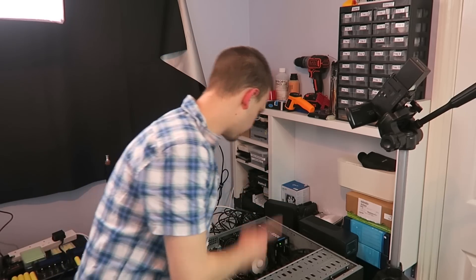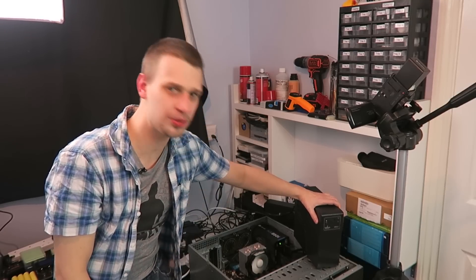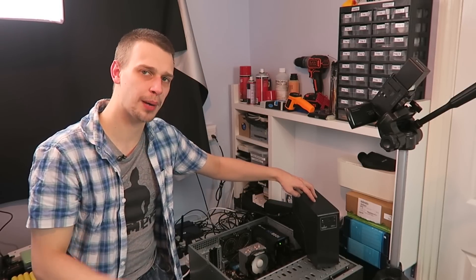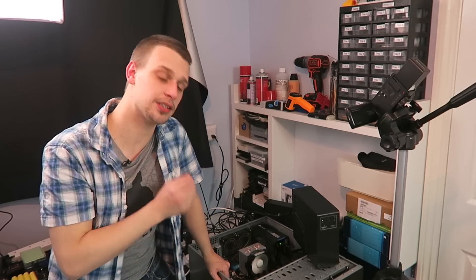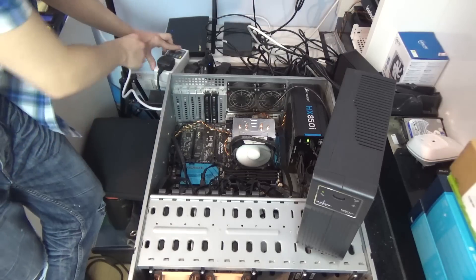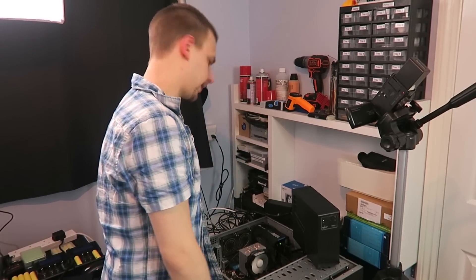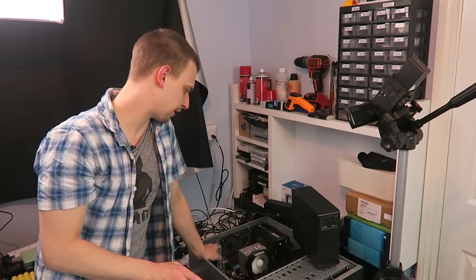Time for a live UPS demonstration. UPS stands for uninterruptible power supply — it continues to deliver power to the machine even if mains power is cut because there's a battery inside. This battery is quite small but will last about five minutes to power this kind of machine. That means while it won't be usable in those five minutes, it will shut the machine down safely, protecting all ten hard drives from failing or becoming damaged. If I disconnect mains power, the UPS kicks in, you'll hear a beep to indicate it's running on battery, and it sends a signal to the machine to shut down. The beeps get faster as the battery depletes.